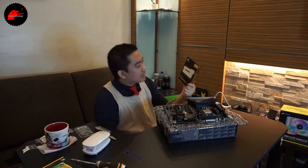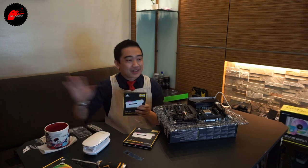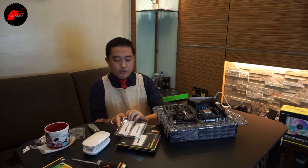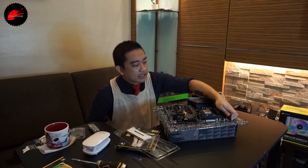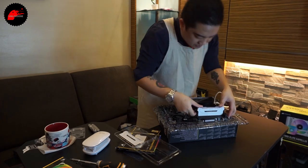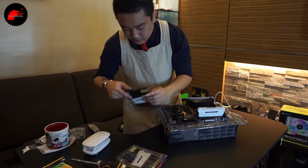Now let's move on to the RAM. These are four sticks of 8GB each, so 32GB total at 3200 MHz. Most importantly — more than the processor speed or GPU power — it's the RGB that matters. That's what makes it faster and gives additional frames. Corsair Vengeance Pro in white, of course, because this is a white build. When using only two sticks, be mindful of dual-channel configuration. This motherboard has a clip on one side only, so figure out the correct orientation. Be gentle when inserting the RAM sticks — firm enough but not too hard.